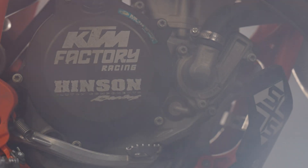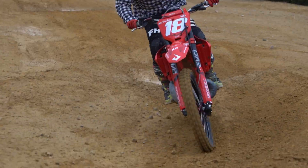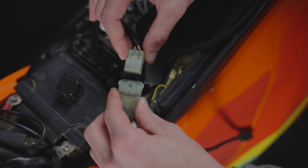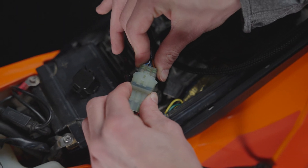You don't have to unplug that big 33-pin connector that might scare some people — it's all through that little diagnostic port next to the ECU. With the KTM, things are pretty simple under the seat, but with a Honda it's tucked way up under the subframe and air filter, so it's pretty intimidating having to pull that out and deal with that 33-pin connector. It's nice just being able to hook up to that diagnostic port right under the seat.